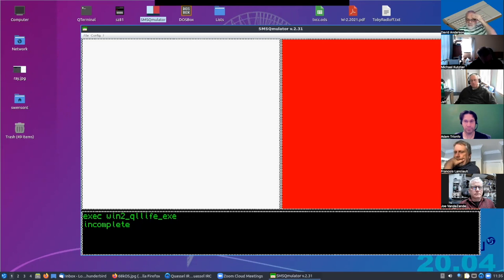There were folks who ended up building their own sort of QLs inside of IBM clone boxes, right? Yeah. The Aurora card plus the gold card, you can throw it in. There's also a couple clones called the Q40 and the Q60. They were ATX mini motherboards that would fit into a standard desktop, but they were basically the Aurora and the gold card in one single board.